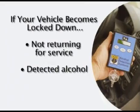If not, you will be locked out. In the event that you have provided a clean air sample and your car stalls, you have a two-minute free restart period in which no sample has to be provided. Do not use Listerine, Listerine strips, or any mouthwash that contains alcohol residues. Do not smoke at least 30 minutes before using these units.